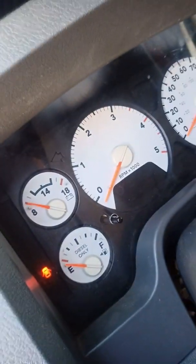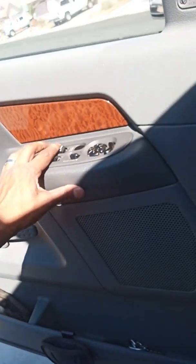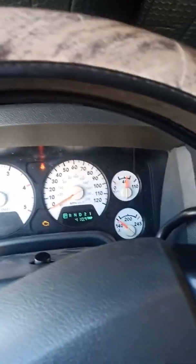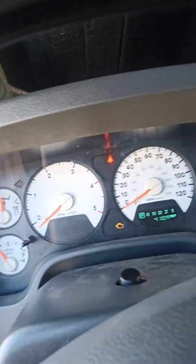Here's the test — key ignition on — my windows are going to work regardless of the TIPM. I'm going to start it. Watch — I have no AC, airbag light came on. Here's how you can bypass it: slap this box, the relays are sticking. Boom — fixed. Airbag light turns off, relays activate, AC is working. But who wants to pop the hood in every parking lot in the middle of summer?